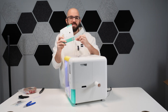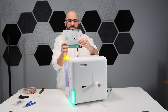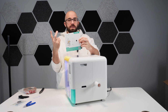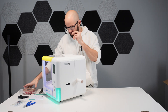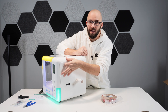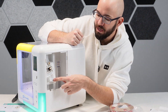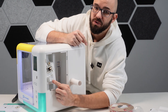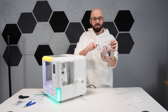Now that we've gone through the menu a little bit, let's get the filament in and get it printing. First thing you might want to do is scan the QR code on the side — it takes you to the AOC website. AOC is the company that makes this. In the top middle you select the app button; the app can be downloaded for iOS, Android, or Windows PC. To load the filament, we'll need to take off this side cover — just grab at the top and pull out. Inside you'll see your feeding mechanism and a little sensor at the bottom which tells the system when you're out of filament so it knows to stop printing.